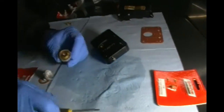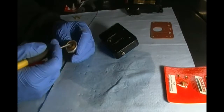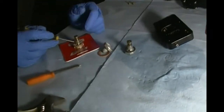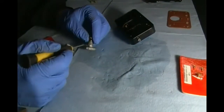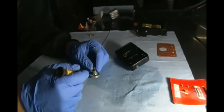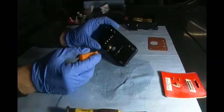These are usually in most carburetors like old Holleys - in those designs these are actually a fixed orifice size and they're not changeable. But because this is an aftermarket billet metering block, they specially have these threaded so you can change them out - which is what I had trouble finding information on, so that's what we're covering today. The power valve is basically just an on/off switch. It doesn't do any physical fuel metering like jets do - it has big windows on it. The Quick Fuel's bragging is they have four windows for more fuel flow when they open. But basically this is off - there is no fuel flow through this orifice until it hits its vacuum of 6.5 to 0, and then it opens and it's basically on. These are your restriction orifices that actually meter the fuel, and those are mostly fixed on most carburetors, but because this is an aftermarket carb, these are adjustable.